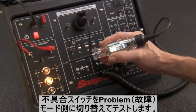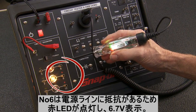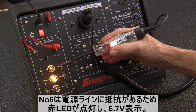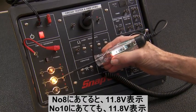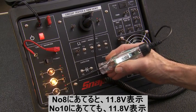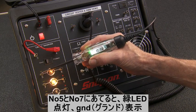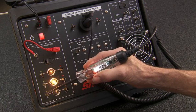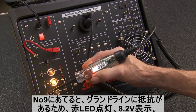Let's go to the circuit diagnosis section. In a 12-volt circuit, pins 6, 8, and 10 on the positive side should read near 12 volts. Pin 6 shows a resistance — a low 6.7 volts reading — whereas 8 and 10 show a correct 11.8 voltage reading. Pins 5, 7, and 9 should read ground. Pin 9 reads 8.2 volts, which indicates a resistance or fault on ground.